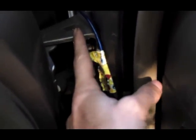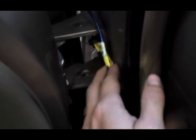Also, the obvious. Do the door jam. I know it's easy. You know, if you got to do it for 5 minutes just to test something, well, don't even run it through the door jam. Just run over top of the car so you make sure you unhook it. This stuff cuts wires. I don't care what you think, what you got. This will eventually cut your wire from this hinge opening and closing. Just because you taped it doesn't mean it's going to stop things.